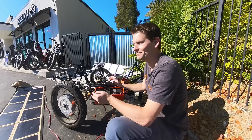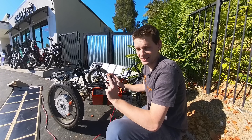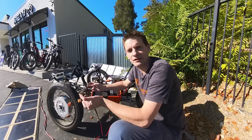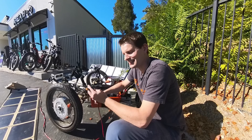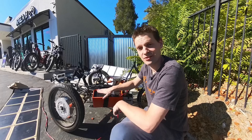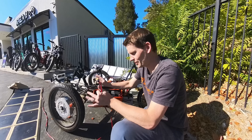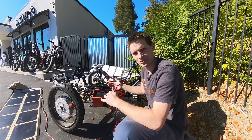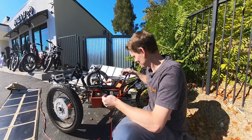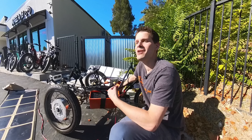I would be surprised if we're getting 50% efficiency out of a setup with a battery bank, just because of how e-bike chargers work. In this scenario, we're not using an e-bike charger at all — we're bypassing it completely. Genesun makes charge controllers specifically for lithium batteries. The disadvantage of course is cost. These charge controllers run about $250, which is expensive, and it has to be matched to the voltage of your battery. These are 36-volt batteries — I've wired them in series so this is really a 72-volt trike, but they're 36 volts specifically so I can have solar charging, which means I need a 36-volt charge controller.